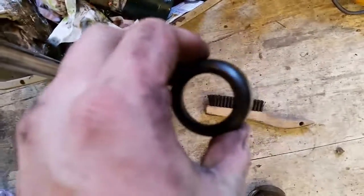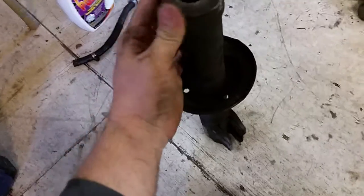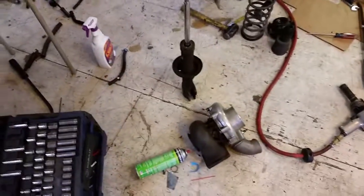They give you this shim for the top that you'll simply slide down over. When inserted right — click — that stops the strut from being able to move at all. Then we just take our threaded sleeve we removed, torque it back down as tight as we can get her. And voila — you now have a brand new strut without replacing the entire strut, just the insert.